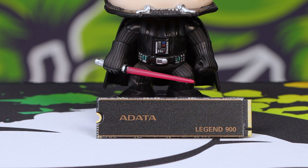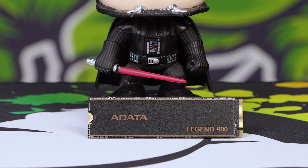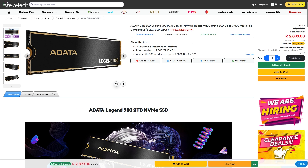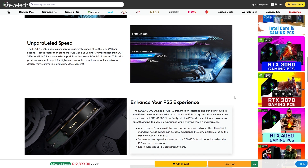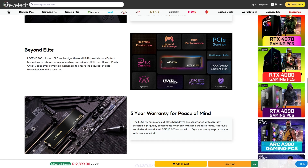The Legend 900 presents as damn good out of the box for what you get and what you pay, and ADATA is a decent brand in general. I want to give this a solid 10 out of 10 because the value pushes it into a segment where it really has no business being — most competing drives at this price are only Gen 3. For gaming with large data files like textures, load times and Windows boot times will be very nice. For heavy write workloads like After Effects, big Photoshop files, or 4K video editing, I'd recommend the more premium drive.